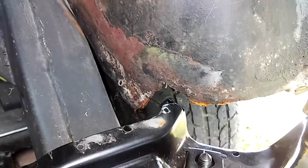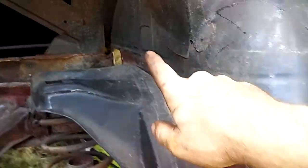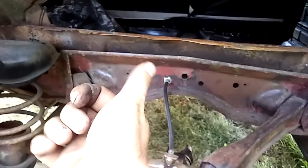As you can see, this wheel housing is supposed to line up — it comes down, I've trimmed all the rot off of it, still got to trim a little bit better and patch it. Eventually down the road I'm gonna put all new wheel housings in it and put full quarters on it, but I just want to patch them for now just so I can get this car where I can actually drive it. If you look over here it's real close to the frame, and if you look on the other side you've got way more space, so the whole body needs to go over that way. I'm gonna shift it over a little bit.